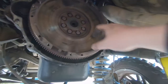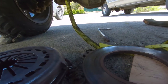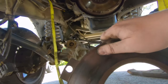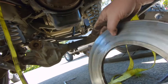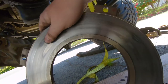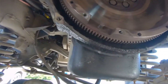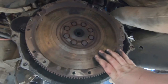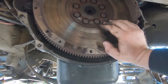The bearing is actually really really good, feels good. Short of the missing bumpers, there is a lot of life left in this clutch. There are a couple of hot spots but they're not really that bad. The machining marks are still visible, the center plate is worn a little bit which is normal, and the flywheel itself has no grooves - it's actually in really good shape.